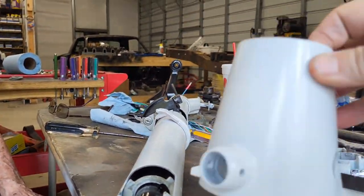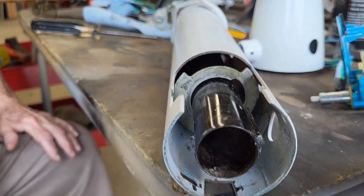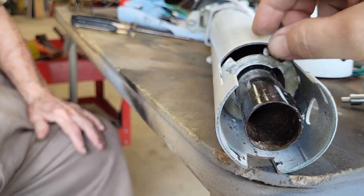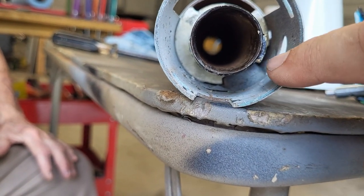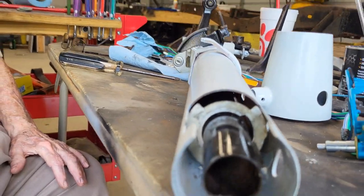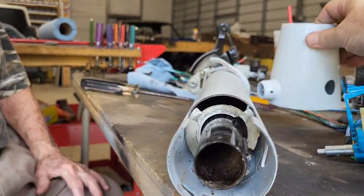The next thing we want to do is get the shift cone in, and before that goes in, we slide this on. It's called a centering washer, and that just slides in here. You got a couple of keyways you got to worry about to slide it on initially and get past this here. This keyway right there has to be lined up with that. But once you get it past that, it can spin, and then you can see the orientation it's in right now, and you see right there how that opening lines up with the tube where the wires go through. So just to give you an orientation. It took us a little bit to figure this out. The book has it, but maybe the orientation they show in the drawing is correct, but it doesn't really say anything. Anyway, I just wanted to show you that. So we're going to go ahead and slide this cone on now.